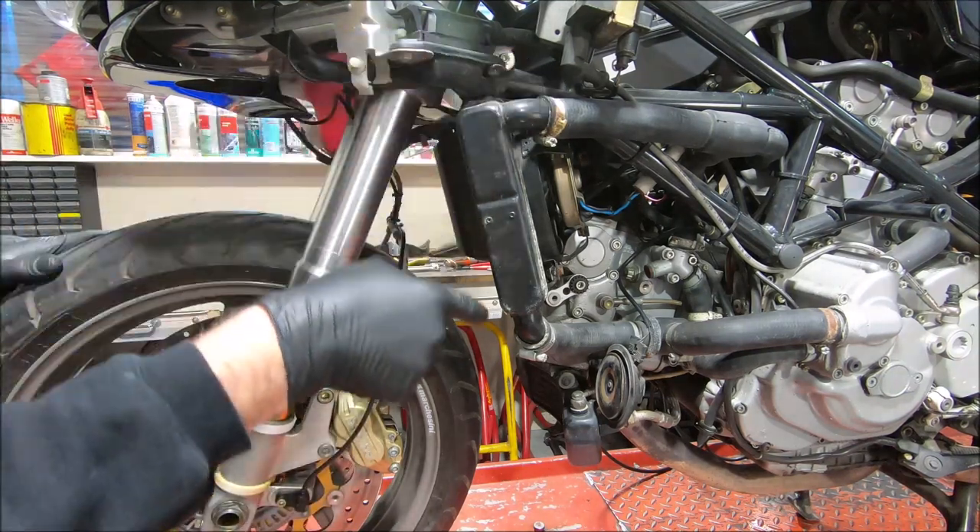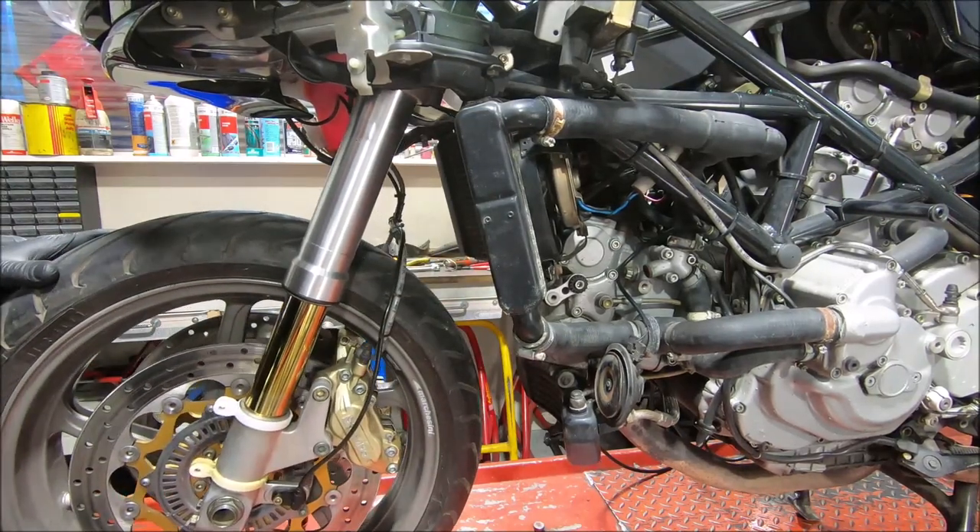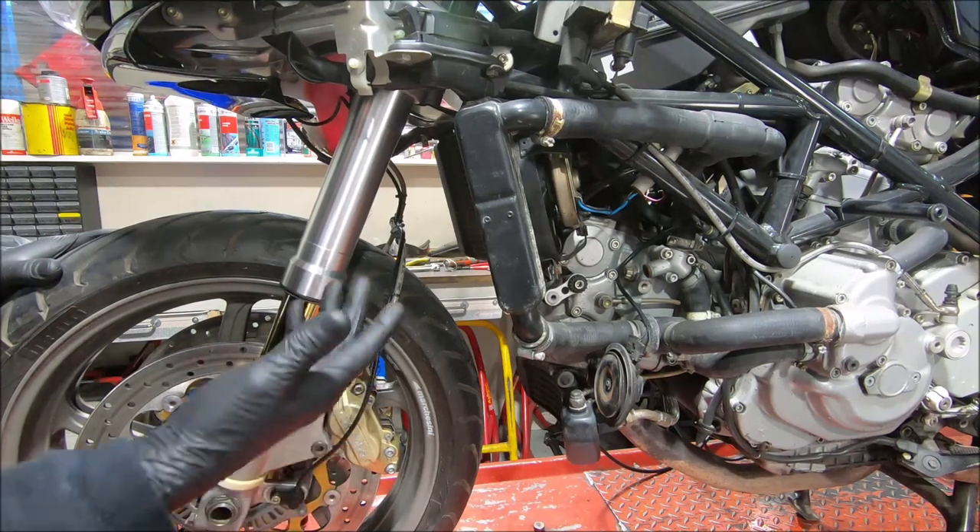If this plate is allowing coolant to just bypass straight through, the coolant isn't going across and back across, and the bike will overheat. So it's always a test worth doing if you've got the bike running with the fairing off.